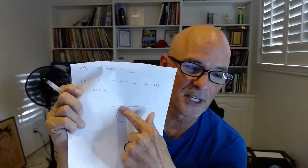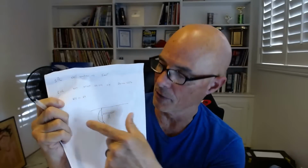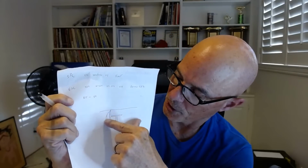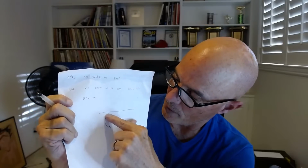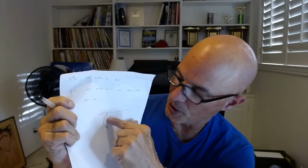We don't want to make this any bigger. We don't want to make the internal diameter of the combustion chamber any bigger. So we want to maintain that. But everywhere below that, we can still port that out. I mean, this is obviously exaggerated, but if we make this arc a little bit, then as this valve is going up, it's going up through and improving the flow of this arc. So what happens is, oh, look, we got more flow because we have more distance away from that valve.